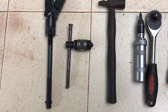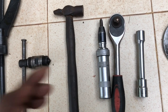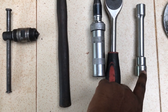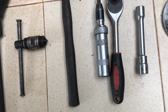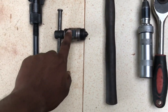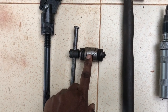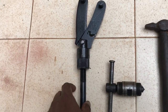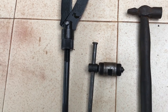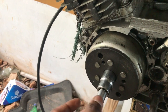Here is a set of tools you need for the entire exercise: the impact screwdriver, an 18mm and 17mm socket — I believe it's 17mm but we'll find out — a ratchet or handle, and a special tool which is the RX-100 generic magnet puller. This tool will lock the magnet. What you see here is an RX-135 engine, and it turns out the nut is 18mm.